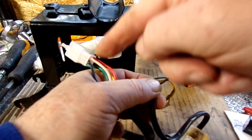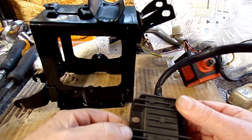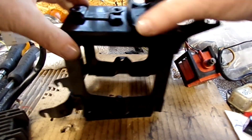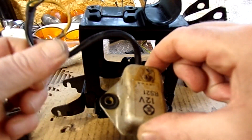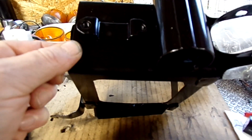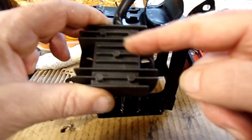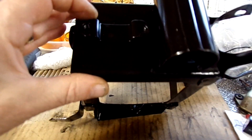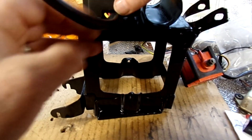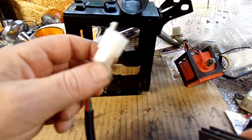I'll put a bullet end connector on that odd black wire. A common approach is to mount it on the bottom of the battery box, which is where the old regulator came from. I'm basically going to fit it there. The only problem is the holes don't line up, so I've elongated these holes so it should now bolt on. I'll do the plug first since it'll be easier to work on while it's loose.